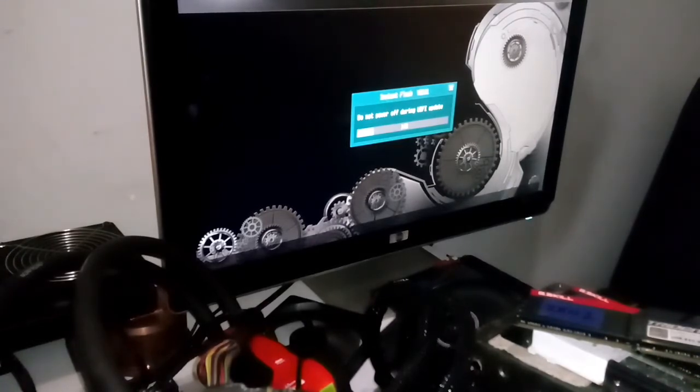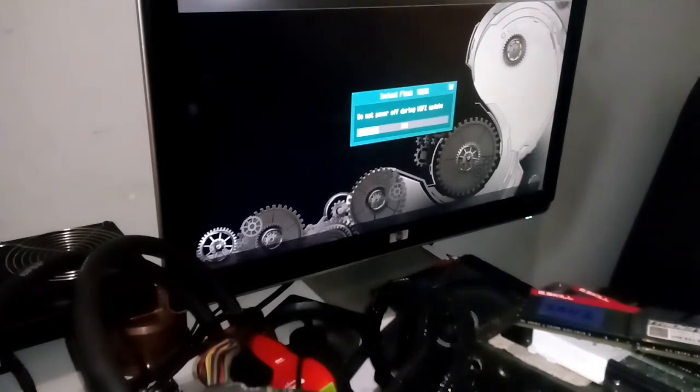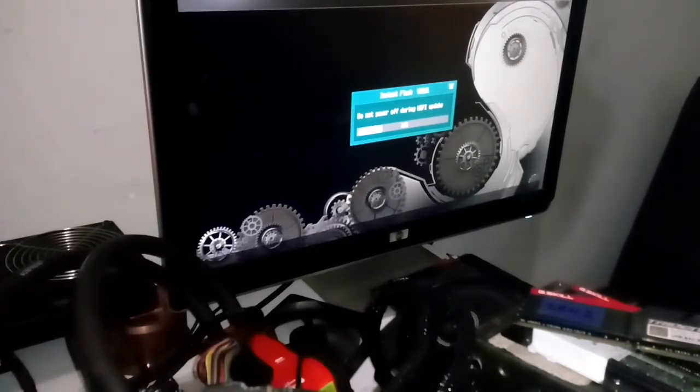Now the reason why it takes so much longer in DOS is because it's actually writing over the entire BIOS. I was having problems flashing forward and backward on the Taichi. An example is 1.94a BIOS. I flashed up to 2.0, it sucked. I flashed back to 1.94, which only had half multis, and all of a sudden 1.94 had quarter multis, but they weren't working, which tells me right then and there that it did not write over the AGESA code and it was not a clean flash.